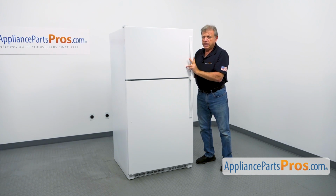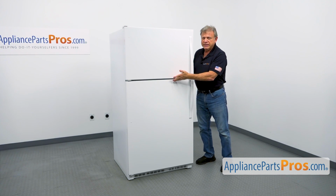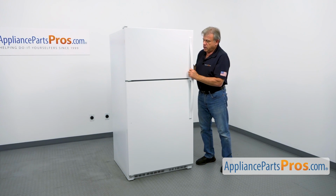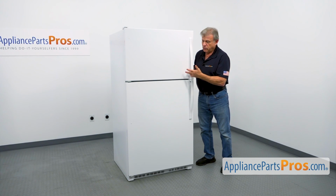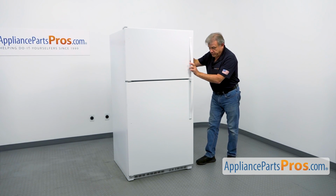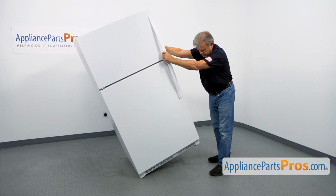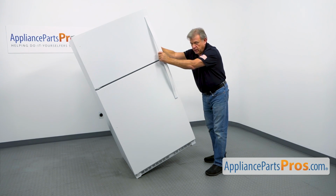Have someone to help you and use this person as the security guard to make sure the fridge is not going to slip. The floor should be better than just a tile, unless you put something to jam the fridge. Also, I would really recommend you to empty it out. First of all, it would be easier, and the second, you're going to save your food. So it just tips like that. Probably about that far. Make sure it's sitting on the solid surface and it's not going to go anywhere.